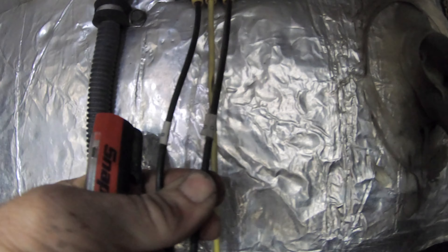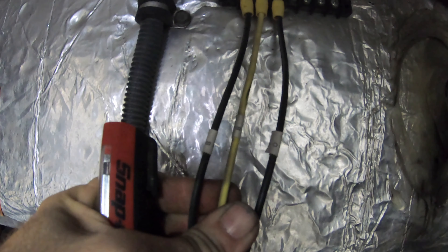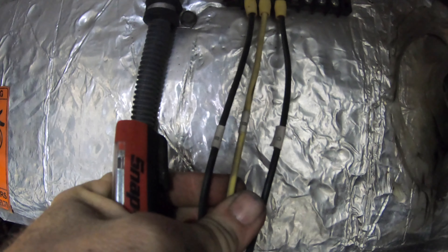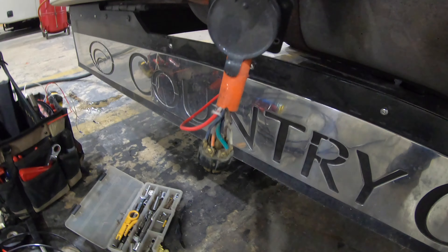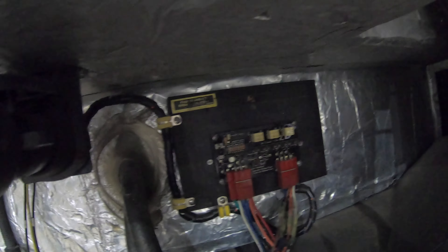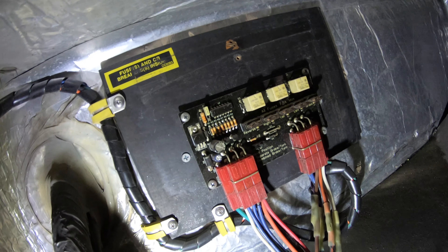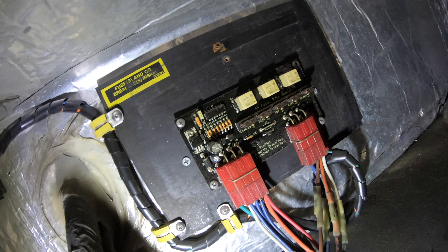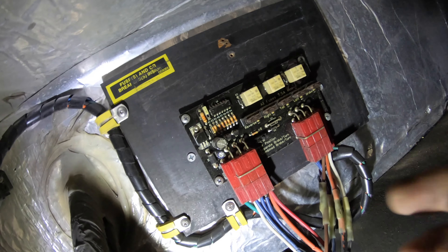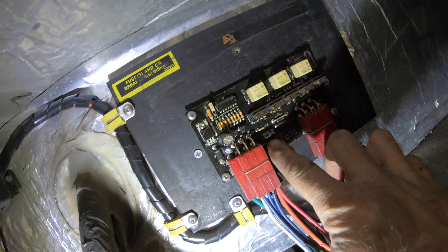You've got another D wire here, which is gonna be black — that's gonna go to the dash. And then this yellow and black, labeled B, those go to the inverter bay. So we've got that wire that's gonna go to the back. While we're back here, we're gonna touch real quick on what Country Coach has called the tow board. This tow board takes all the coach signals and then has fuses for the outputs. This is one of the newer generation boards, it's already been replaced from the factory. This is where you switch between tow combo brakes and tow separate brakes.